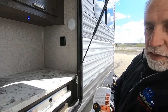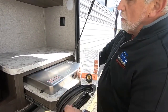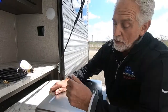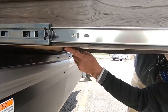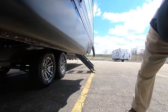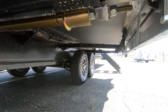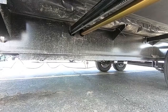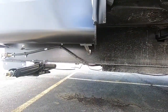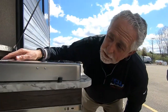Coming with this is the quick connect hose that works your stovetop. People ask how to hook that up — underneath your cooktop you've got this little nipple, that's where you put one end of the quick connect. Then right underneath there, over to the left on the frame, that's where you plug in for the LP connection for your stove. It's an extra-long hose because that connection happens to be a little further away than normal.